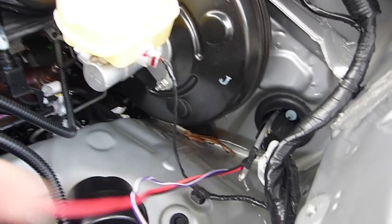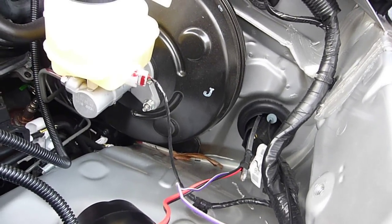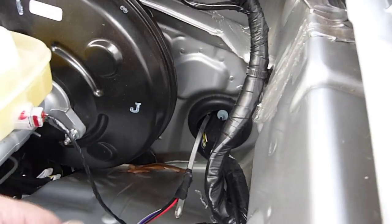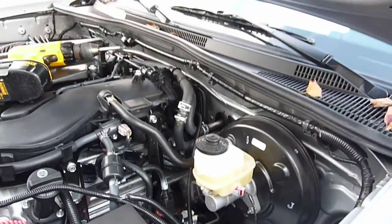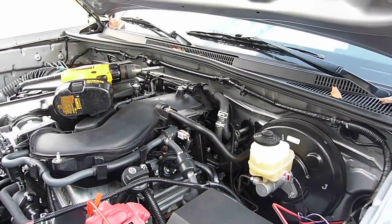That extra I've got to connect to that screwdriver. All you've got to do is go on the other side — inside the passenger compartment — and pull that screwdriver through that's taped onto the wires. Pull them through. You're going to have a rubber grommet and you're going to have this wire loom so the wires will never be rubbing up against metal. You're just going to secure them by putting wire ties with the factory looms, and that's basically all you got to do under the hood in this car.